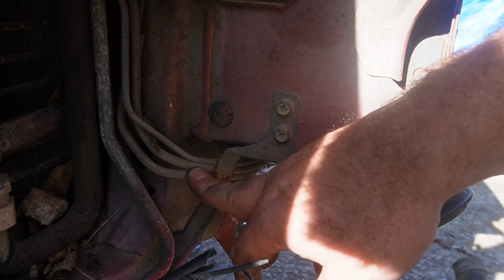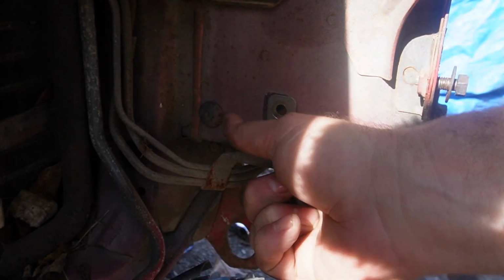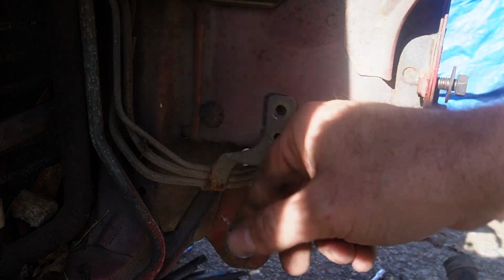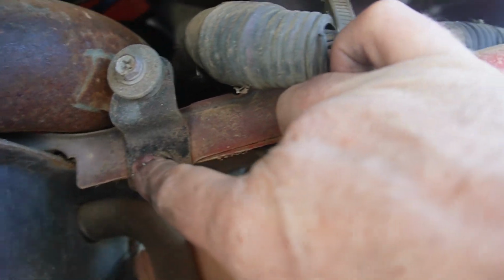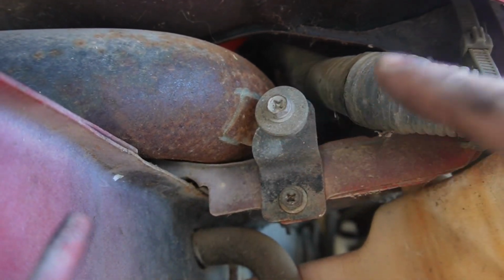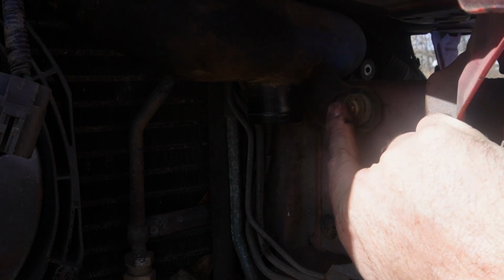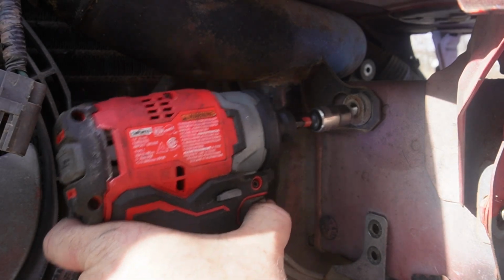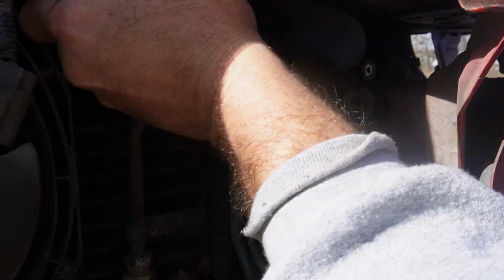I'm not exactly sure what these are for on the carbon canister, but this is part of the bracket. And we're going to have to take this intake tube out. But that's also part of the hoses that are right here in the delete as well, so videos may intercede with one another. So there's this bracket here to get your intake tube out. There's a bracket right here. Leave this bottom one if you can, but take out this 10mm right here so we can get this tube out. Once you get one on the other side out, there's one right here. I'm sorry if there's a glare, but there's another 10mm bolt sitting right here. Make sure you keep those bolts so you don't lose them.